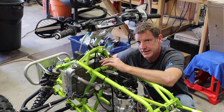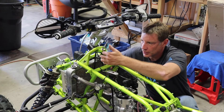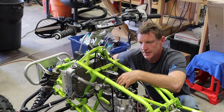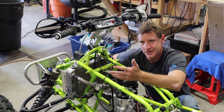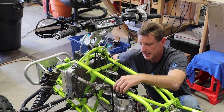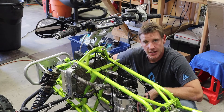I always like to have a backup CDI, especially if it isn't OEM. I don't have a backup CR setup, so if this were to go bad, I wouldn't know if it was the stator, the CDI, or the coil. That's kind of the other thing with running a setup like this — unless you have two setups to swap out, if something goes bad you're not really going to know. Whereas with OEM, it's easier to have two CDIs and a couple coils sitting around.